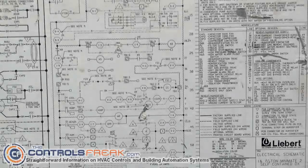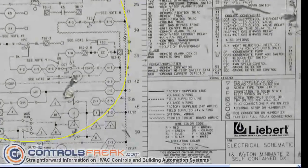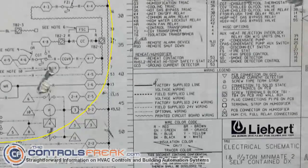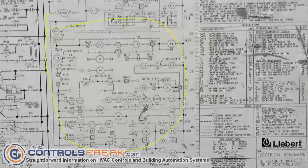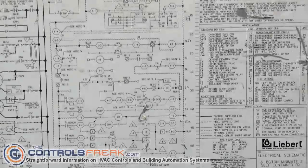One other thing to note from looking at the overall diagram — you'll notice all the squiggly lines. All these squiggly lines, as we looked at in the legend, represent printed circuit board wiring. So in actuality, by getting your head up into the unit and taking the covers off, you're not going to see all these wires anywhere. These lines are actually circuit board traces on that control board that we decided we were going to rip out, so you're not actually going to see a bunch of wires up there. The actual factory-supplied wires are going to be the dash lines and the solid lines, and those are usually wires going to the actual devices like the motor and compressors.